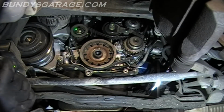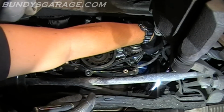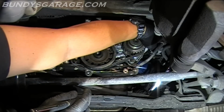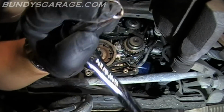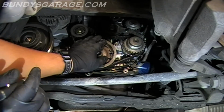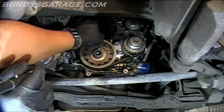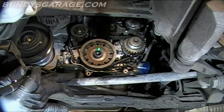There's a mark here on your oil pump. There should be a mark on the backside. And then right back here, this hole, you should be able to stick a screwdriver in here and lock that into place as well. So, spring right here. Should be 2 springs. Don't lose this key. There's a key right there. Don't lose that.